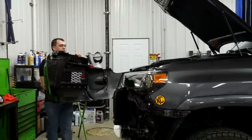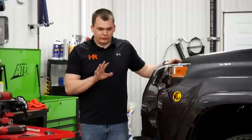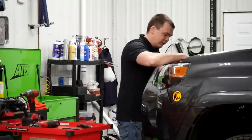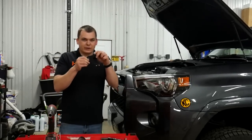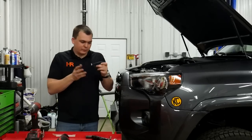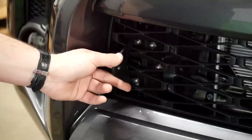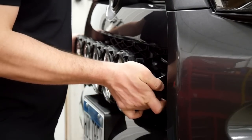At this point you can throw the bumper back on loosely and make sure everything's where you want it before you continue. It wouldn't be a bad idea to throw a bolt in the center up top just so the bumper doesn't fall — the last thing you want is to drop the bumper of your nice 4Runner. There's one final bracket that reaches into the grille and bolts to the bracket assembly we just put together. From there you install the light bar through this hole. Everything we've got installed right now is loose — the last thing you want to do is tighten everything down and then find out the bar doesn't fit.